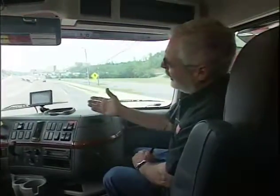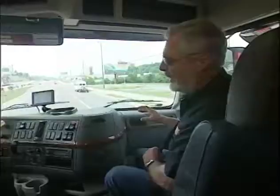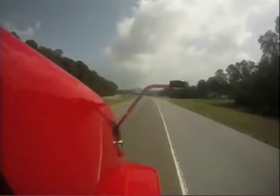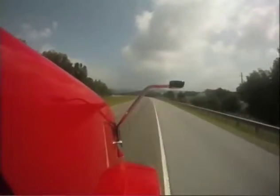We've got the two monitors lit up out on the road — beautiful visibility. Again, that's 65 degrees, and the angle of the cameras is just right. They'll move a little bit when idling with the hood shaking or going down the road, but the image on the monitors is very stable — good color monitors. It eliminates all your blind spots. Also, big mirrors hanging on the truck break up the wind and hurt your fuel economy; these have been wind tunnel tested and actually pay you back in gas savings. You can also hook the system to a recorder, so if someone drives into the side of you, you've got a videotape to show the DOT or a judge. It's a great way to protect yourself if you're an owner-operator.